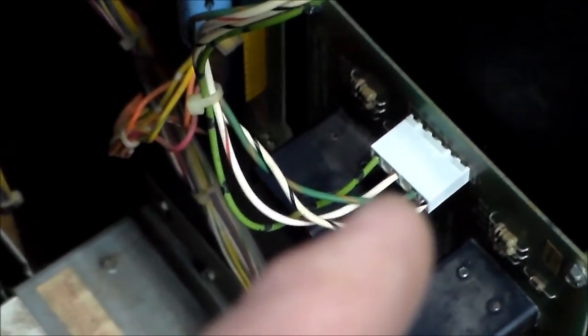what we discovered was that the top connector had a pin on the white and red wire, which is the left speaker, that would not work. So basically, the wire was not connected to the board. It looked like it was, and everything tested good, but after we got out the multimeter and tracked it down, there was a bad connection right there.